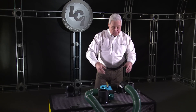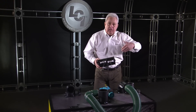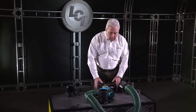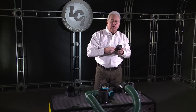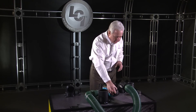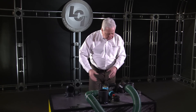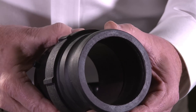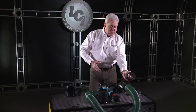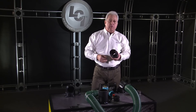If you need an extension, extension hoses are available. They come with a dual female cam connection so you can simply add an extension hose for extra length. The kit also comes with a cam plug, and there's also a cam plug available with a three-quarter inch hose fitting so you can drain just the gray water separately. If you want to use a portable transfer tank, there's an adapter that goes from cam lock on one end back to the bayonet fitting, so you can insert it into the cam fitting on the RV and safely transfer to a portable tank if necessary.